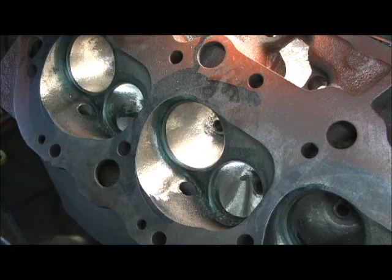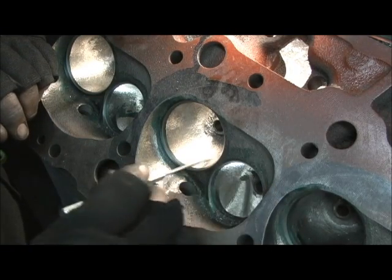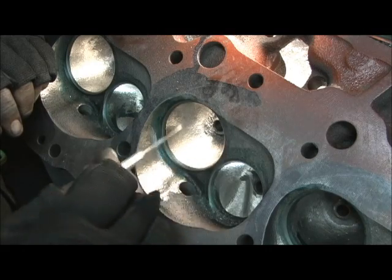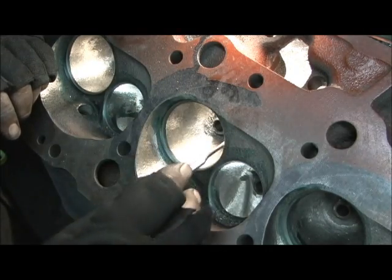Anyway, wanted to show you that. The green, gray, green, silver, shiny — reblended, valve job done, opened up where the 60-degree radius blends into it to match all that awesome bowl work that was done to it. Now we've got a hell of a window to release it.